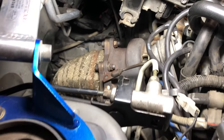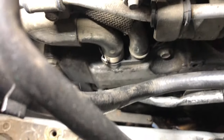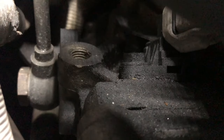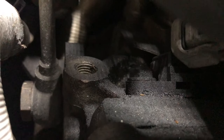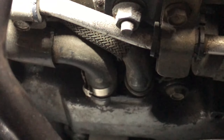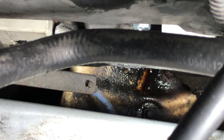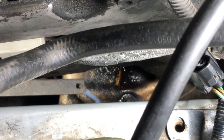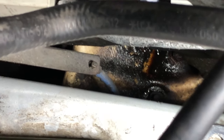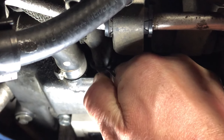Let's find the camshaft sensor for bank one — that's going to be on the passenger side. Going down, down, down. I think that's it right there — I can see the 10-millimeter bolt and the connector, sitting right below the coolant overflow tank. You're going to pull off the two hoses like I did on the other side. I pulled off the intake just to get some things out of the way, and I noticed a puddle of oil down there. My valve cover gaskets might be leaking — that's pretty notorious on these Subarus. That's another issue to address at a later date, but not too late, because yeah, that's not good at all.